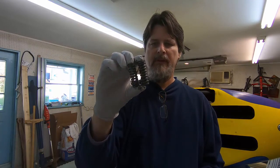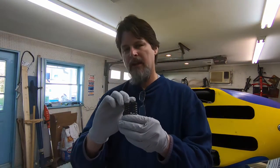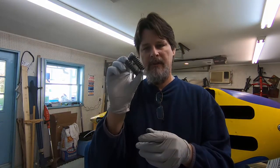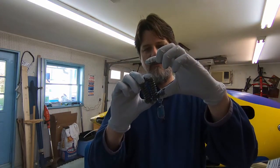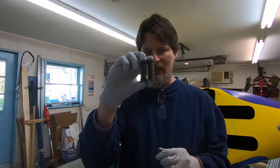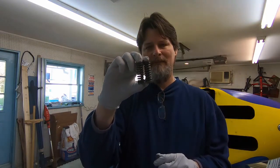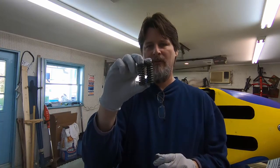Okay, so one of the first things I'm going to try is replacing the springs that are in there with the original springs, but this is really only half of it. If you recall from my video when I replaced the springs, this is the lower half. There was another softer spring on top, which gave it about this much spring. So I'm going to see if this is enough clearance, if this will allow the velo to ride just fine. It will obviously lower it down a lot, but I'm going to see if there's enough clearance inside the wheel well for it to operate properly.